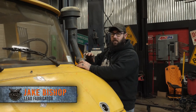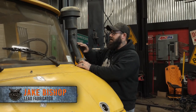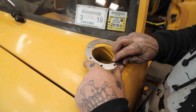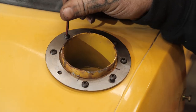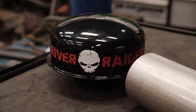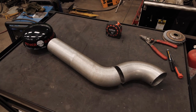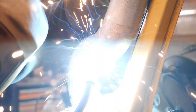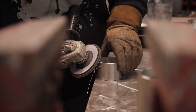The factory snorkel on this is old, outdated, and bulky — you can see all the weld seams and the pinch seam. So we're going to remove it and put in our River Raider style snorkel with mushroom cap. It's all going to be made out of three-inch mandrel bent tubing. We blend all of our weld seams so it'll look like one piece and be completely seamless.